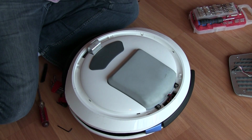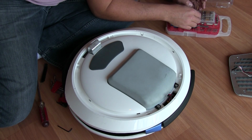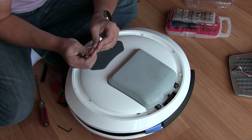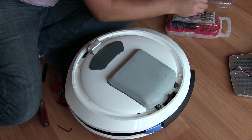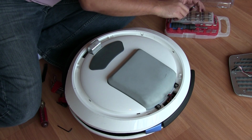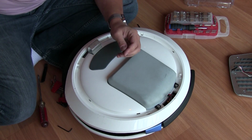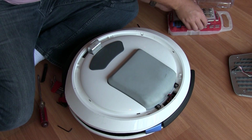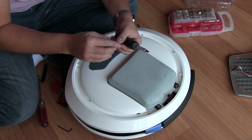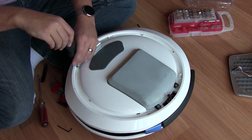I mentioned before that my flathead screwdriver wasn't really cooperating with that type of screw. Let's see if this bit is any better. It bites in. I don't want to. Nah. The Phillips, the indentation on the screw itself is quite shallow, and I don't want to hollow that out. So let's do it again. That's much better. That bites into it nice. And this way we could properly torque that down as well, without running any damage, or risk of damage, I should say, to the screw.